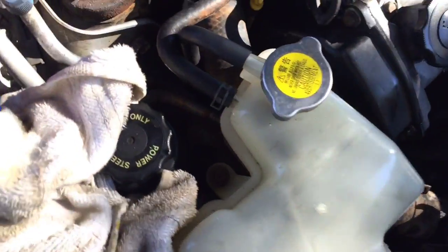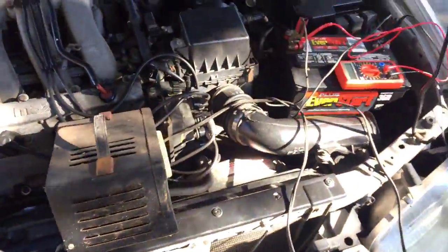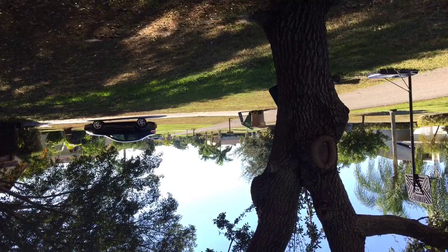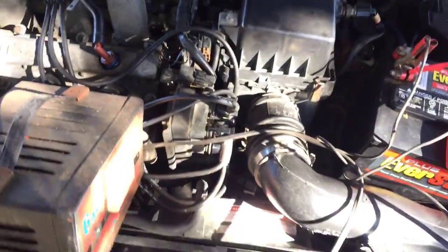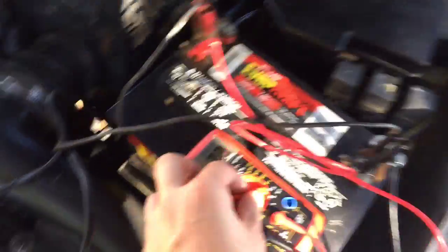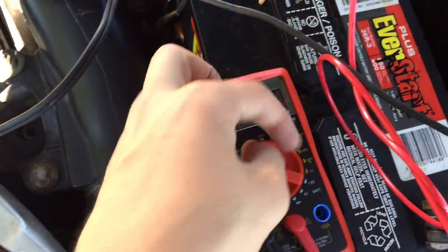There's some sizzling going on — probably from the coolant reservoir. The battery went down to 8 volts so I have to plug it in. If you guys don't know, the reason I need to fix these oil leaks is because the oil is leaking onto the alternator and killing it — so I'm gonna need a new alternator. The battery died and the car stalled when I pulled in after idling. Now it's at 12.3 volts and I need to wait for it to get to about 12.6 before it'll start again.